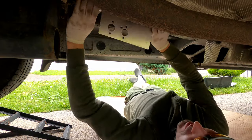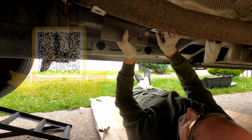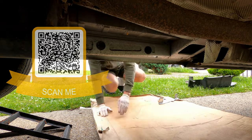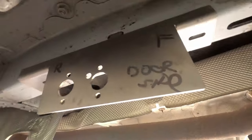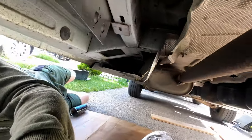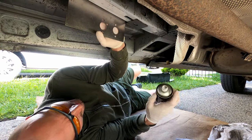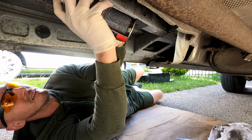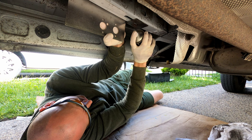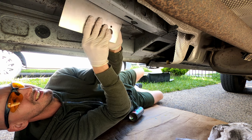To mount a diesel heater to the chassis, we're going to need a stainless steel bracket. I bought it off eBay, I'll leave a link in the description for you below. This bracket is designed to work with rev nuts, which can go into the existing holes in your chassis. Now, because I don't have a rev nut gun, I made my own holes and put the threads in there. Or another option, you can simply use tek screws, which will hold your bracket in place.